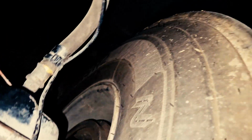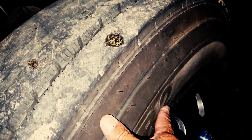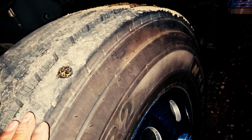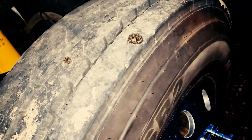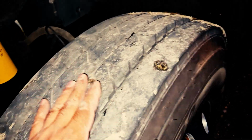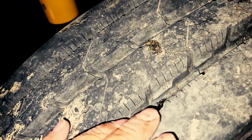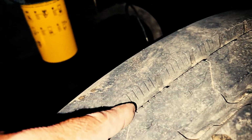I'll inspect my tires' inner and outer sidewalls to ensure they're properly mounted and secured. There are no abrasions, bulges, nor cuts. These are steer tires, and they can only be virgin radials. They cannot be retreads, recapped, or regrooved tires. I will also inspect the tread depth in every major groove with a tread depth gauge, and my tire pressure with the tire pressure gauge here.